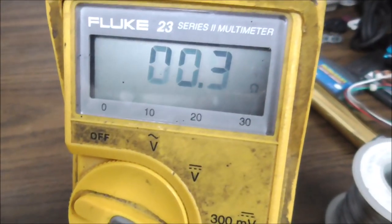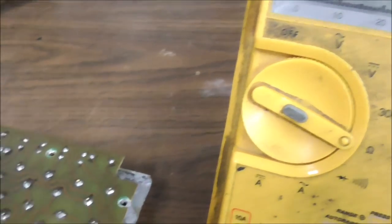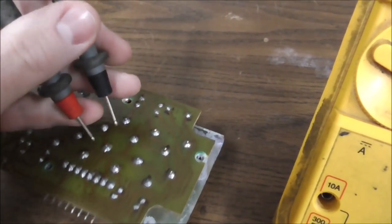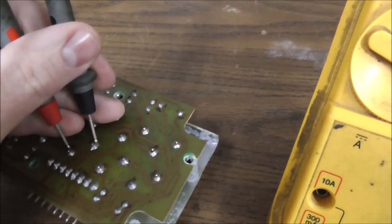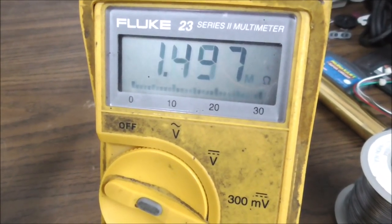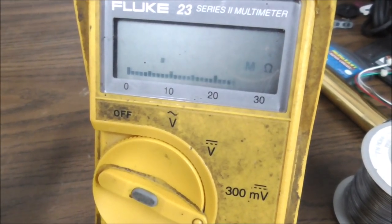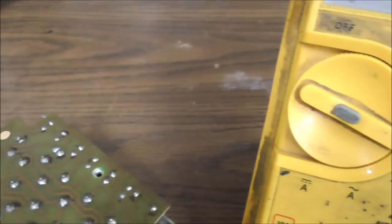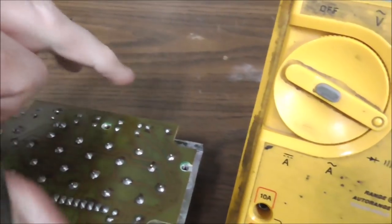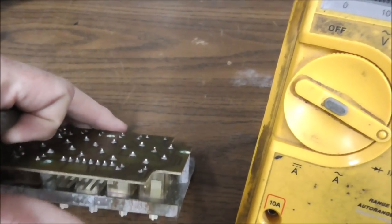All right, look, 0.2, and my meter's off 0.2. Okay, so whenever you push it in, these two connect now. Okay, so let's try number 8, which isn't working right. I'm pushing the whole thing down. You see, it never gets to 0.2. I did it a minute ago while I wasn't holding the camera. It's not really connecting. So these two are not connecting when the thing goes down, because there's just too much dirt and resistance inside of that thing.